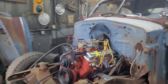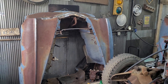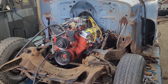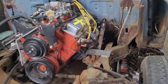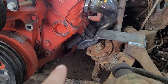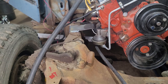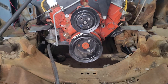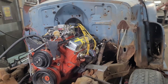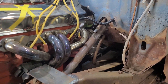Check out what me and Arco got done yesterday. We pulled off the front clip - it was just a lift off, all unbolted. We built some motor mounts using part of the stock Chevy truck ones, then modified them to fit this frame. The motor is sitting nice and centered and level, and the rear tail shaft is going right through the X-pattern in this frame.